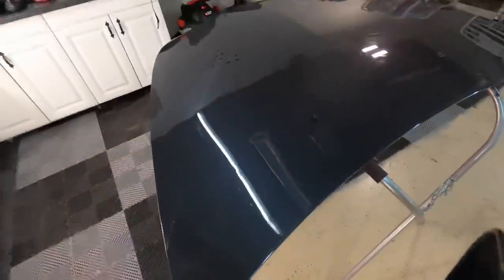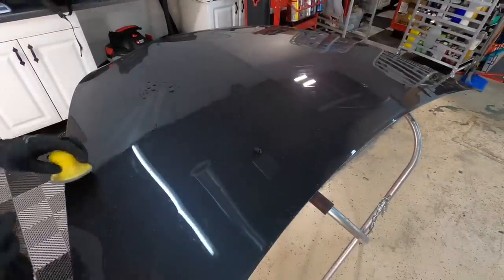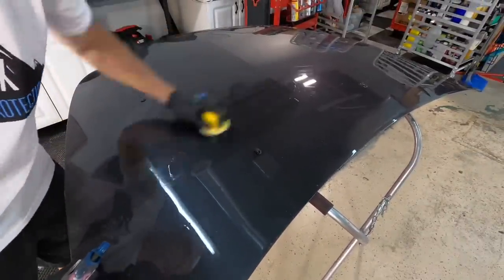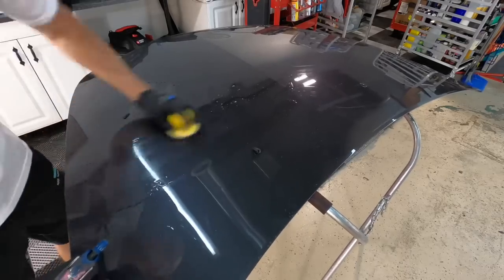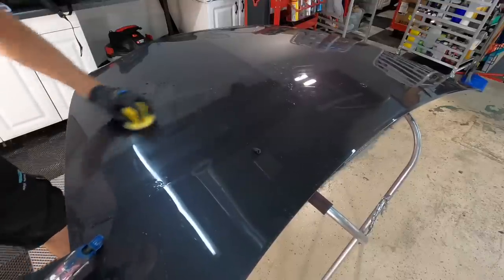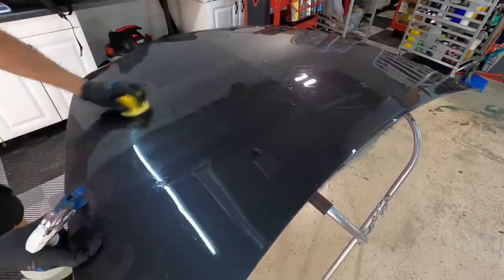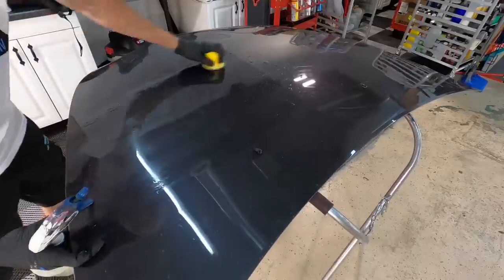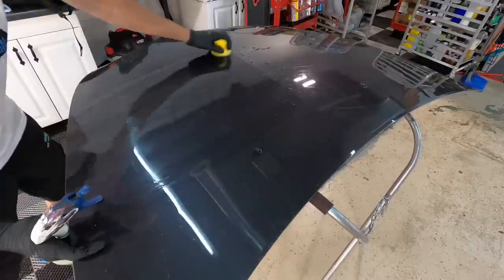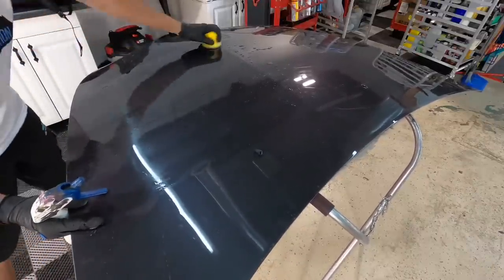Will it be easy to tell if you've gotten all of it? No, and it's not important. You can remove it and recoat, or do whatever work you need to do on the panel and then lay down the coating. 100% of it does not have to be removed, and it's impossible to tell if it would be anyway. To give you peace of mind, with our coating I do recommend wet sanding first with either 3,000 or 2,500 grit, and then polish out from there.